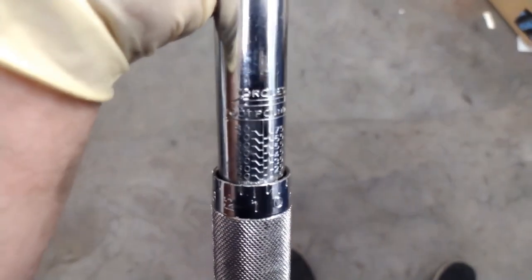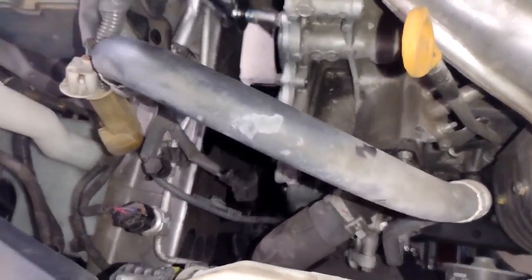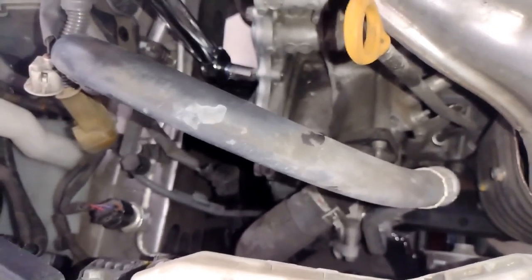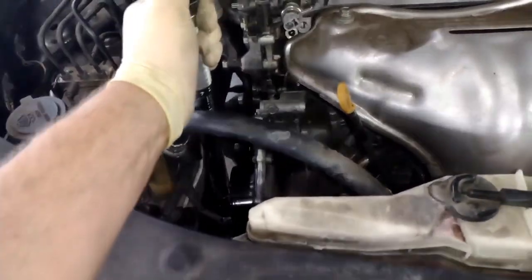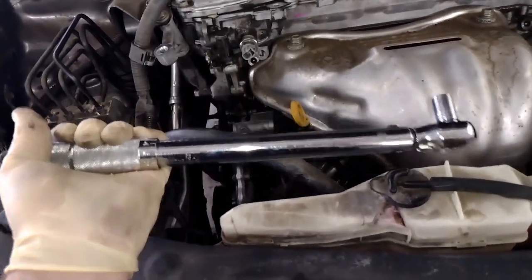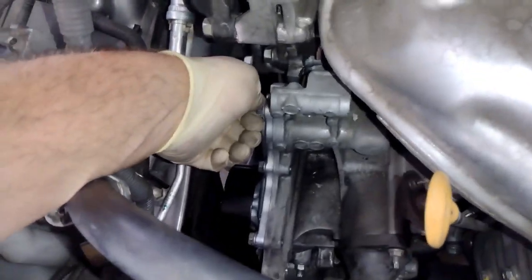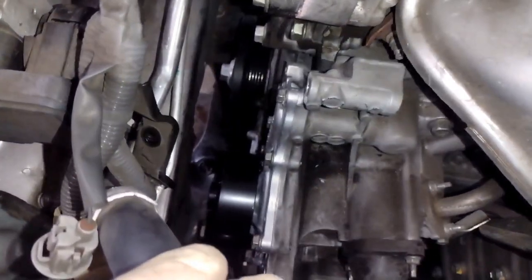Got my torque wrench here. And I'm going to link a torque wrench in the description. You set your torque wrench, and then you just try to get it in here as best you can. You tighten it until you hear it click. It'll just go click, and then you know that the bolt is set to the correct torque. That way you don't over tighten it and snap the bolt, and you don't under tighten it so that it starts leaking. It's just the best way to go if you can do it.